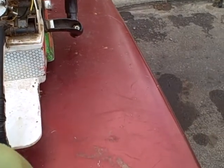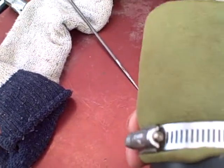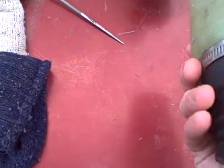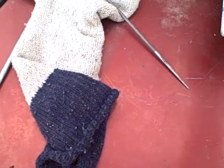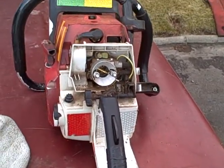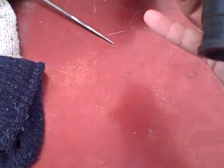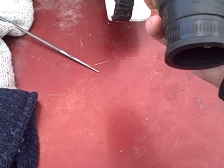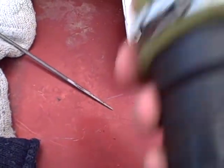You see this filter here is what normally they fit on there — you take this filter and it fits on. They're not much good in my opinion; these are pretty much junk when they come from the factory. You're better off to get a fernco coupling. This is just a standard inch and a quarter, which is the outside diameter on this one. There's some Huskies that are an odd number, so you have to be careful. What I do is you've got a fernco coupling, just a standard inch and a quarter by inch and a half. You put an inch and a half by inch and a half female slip glue PVC fitting in here, drill a bunch of holes in it to get more air, and put this filter system on the outside.